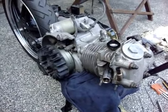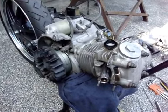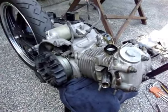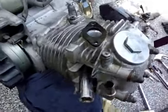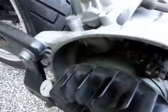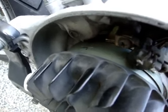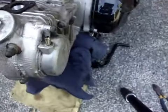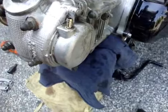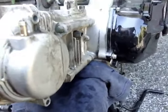Okay, today we're going to take apart the Yamaha Mio engine. It's a 113cc 4-stroke single overhead cam. So first you have to make sure your timing marks are correct. That's a timing mark. You just set it on the pointer, and then after that you have to take apart the cam gear timing cover if they are aligned, so it makes it easier for you to bolt things